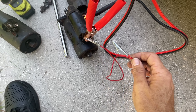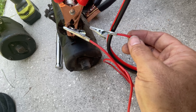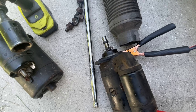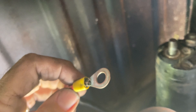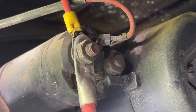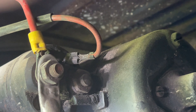You can also use a little dielectric grease to keep corrosion from happening. Now, here's how to test a starter from a good battery: take some jumper cables, put your positive on the positive battery terminal and the power post on the solenoid on the starter. Take the negative from your battery and put it on the starter itself to ground it. Then use a jumper wire or a screwdriver to touch the ignition source — you'll see the starter engaging.